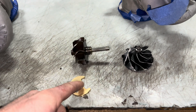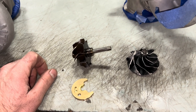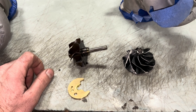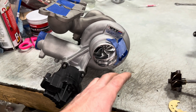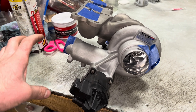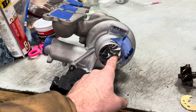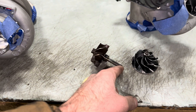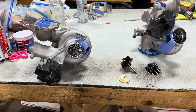A way that could have happened, if everything was in good condition, is the possibility that he didn't have a blow-off valve, or the blow-off valve spring was so tight that it didn't release pressure like it should. If that happened — because this turbo on the engine is revving out high at max boost — when you let off the throttle, it should release pressure through the blow-off valve. If it doesn't, that pressure puts a lot of force on the fins of the compressor wheel and can break the fins off. When it starts putting pressure on that side of the wheel, it could also break the shaft in half. That's a theory — I don't know this guy's whole setup, but I can only make predictions of what I think happened.